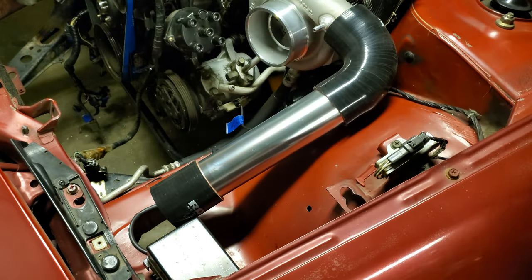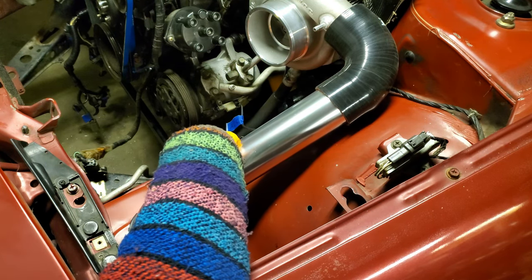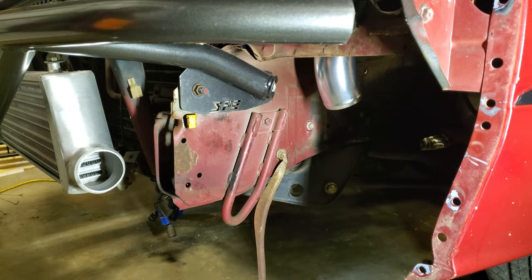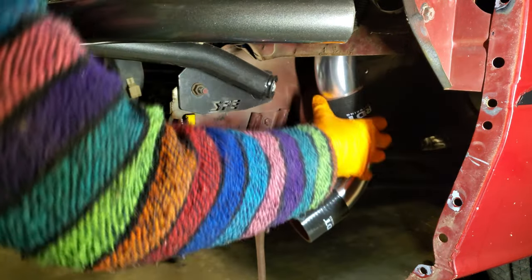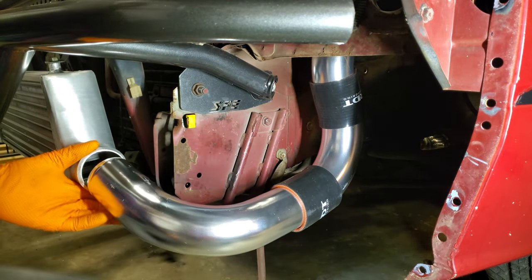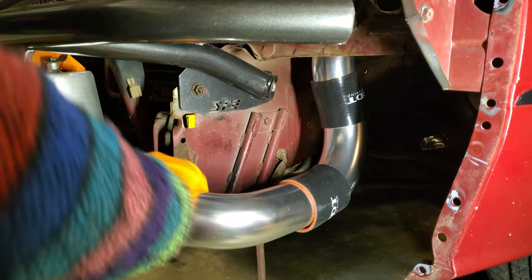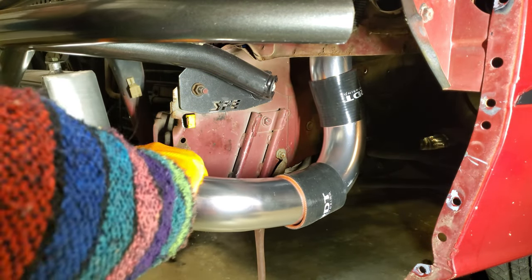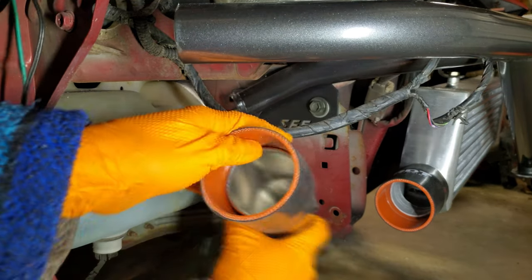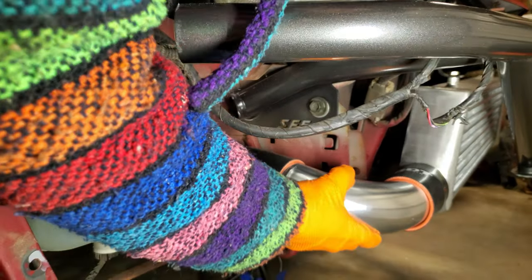Ideally, we'd like to get this all welded up properly in the future because originally we didn't really think that intercooler piping would be all that important, so we just ended up picking up a universal kit on eBay. That being said, after seeing the fit on some of the portions of this system that we put together, we would probably have been better to try and track down the CX Racing intercooler kit for the KA24ET or had something custom fabricated. This kit might get trimmed up in spots somewhat off camera as well, depending on how well it holds up to some of those weird angles and if those couplers are going to pop off with excessive boost pressure. Until then, it really should be fine enough to hold up to 5 psi of boost.